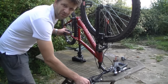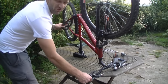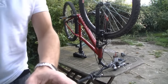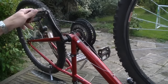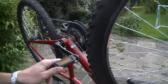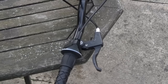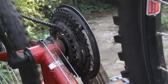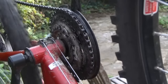With the left-hand handlebar just slightly off the table so I can turn it, I'm going to turn the wheel, operate the grip shift, and see how the derailleur's performing. It does work but I think it just needs a little bit of adjustment, so I'm going to turn the little cog to tighten up the cable a little bit. Now giving it another go — in third, down to first, up to second, back up to third — it all seems to be working smoothly now.